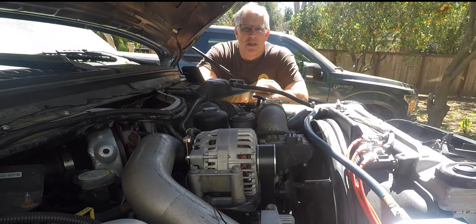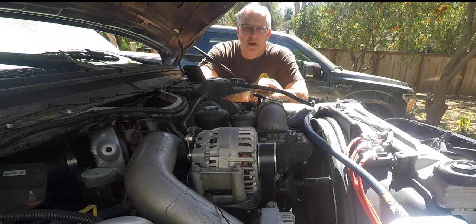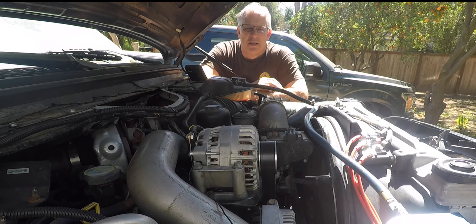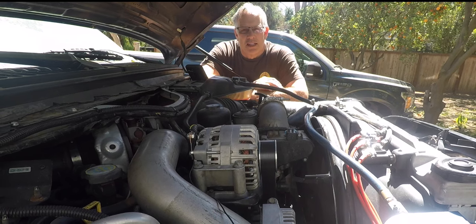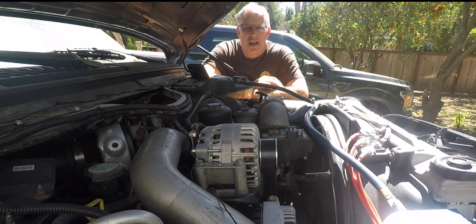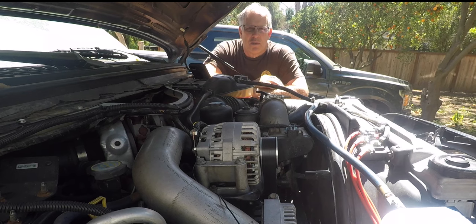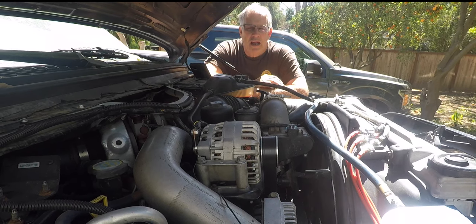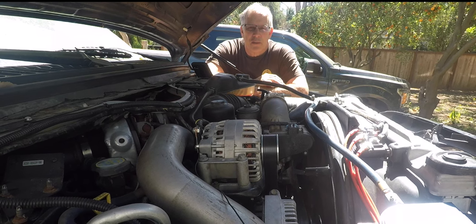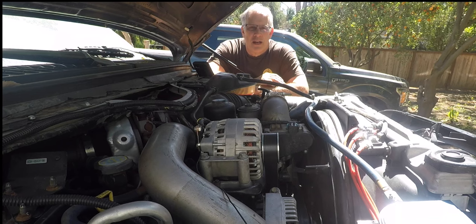The way to do that was to help the alternator run cooler. The only way I can really do that is to remove some heat from the alternator. It's very difficult to bring air to it based on where it is, so removing heat seemed to be the next best thing. I decided to remove the diode bridge from the rear of the alternator, place it in a fan shroud where it could be cooled. That removes about half the heat generated in the alternator and also provides additional air circulation paths in the back for the alternator fan.